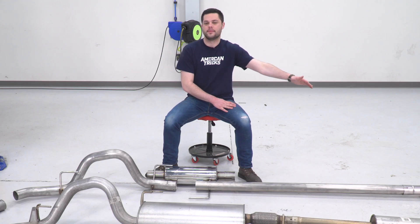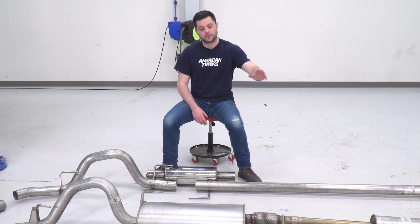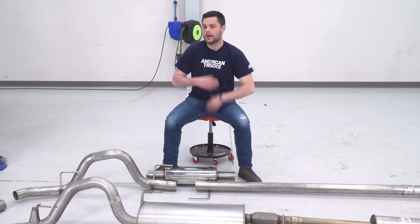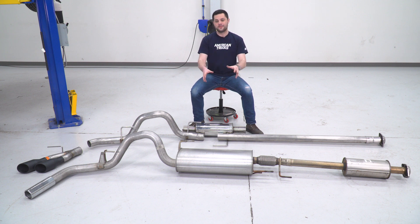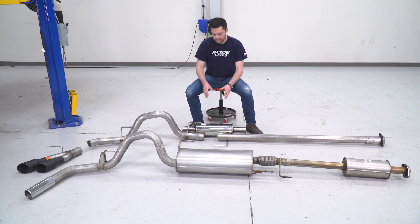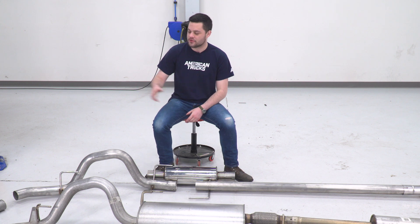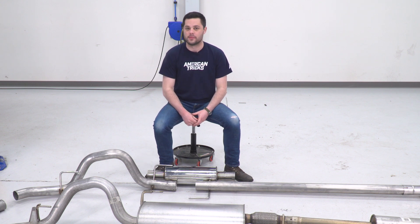Let's dive into each of these kits, starting up at the flange and working our way back to the tips. The first difference is the inlet pipe diameter — we're going from two and a half inches out of the factory to three inches with our new Roush kit. We're also completely losing the resonator on there as well as the flex pipe. All three in combination are gonna be good for exhaust flow. The big difference is right in the middle — our muffler. Over there on the factory, you can see just how big, restrictive, bulky, and frankly heavy that factory muffler is. We're ditching a lot of that extra heft for the Roush muffler, which is straight-through. At the back of that muffler, we have the same diameter piping — three inches. Our new Roush kit has dual four-inch slash-cut tips embossed with the Roush logo and that awesome flat black finish — a huge upgrade over the three-and-a-half-inch single polished tip you get out of the factory.